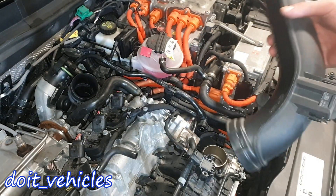Next I'm gonna show you the values you need to read at the connector when you have the ignition on - I'm gonna turn the engine on. Connect the black terminal in the corner on the left: 10.68V. Next pin: 0.02V. Next pin: 5V. Nothing on those pins. Moving to pin 2 - between pins 2 and 3: 10.68V again. Pins 2 and 4: 10.07V. Pins 2 and 5: 10.68V. Pins 2 and 6: 10.68V.